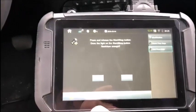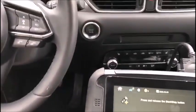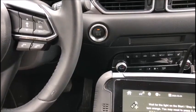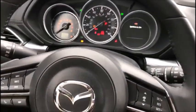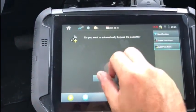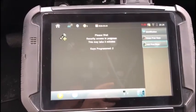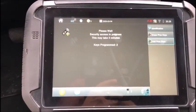It did not press — only the start/stop button. Give it another press, and now it has gone orange. On the last line here: press and release start/stop button, then turn ignition on. Our ignition is on. Is the start/stop button orange? Yes it is. Do you want to automatically bypass the security? Yes we do. We are now bypassing the spot where everything used to fail — the in-code/out-code conversion — which you no longer have to do.